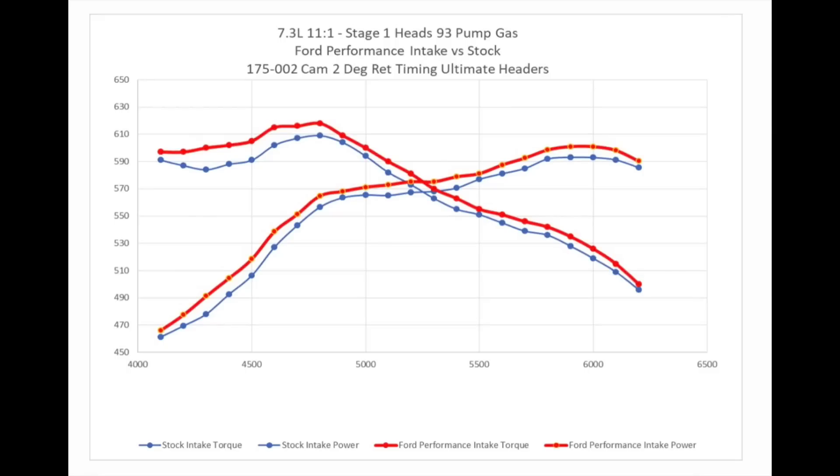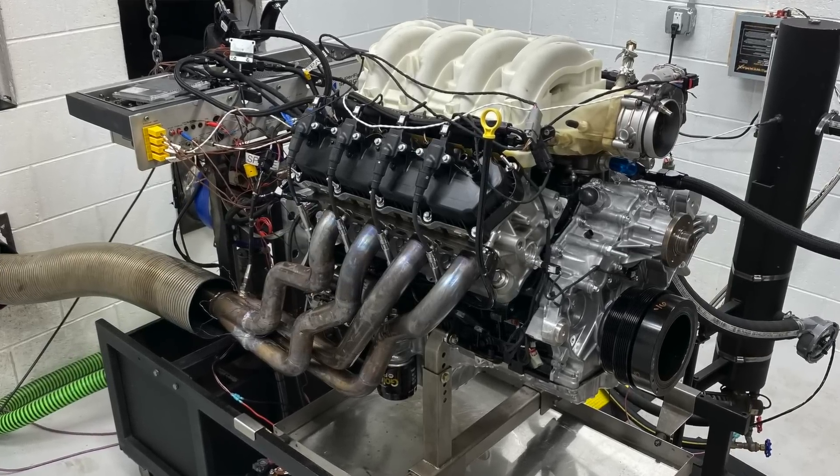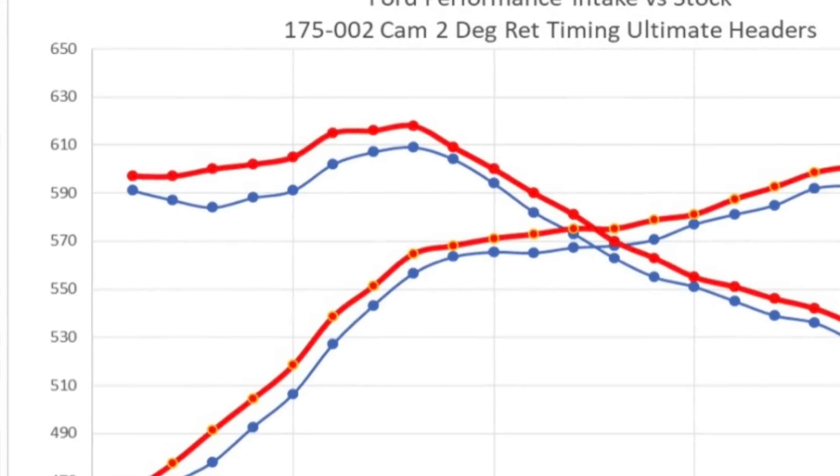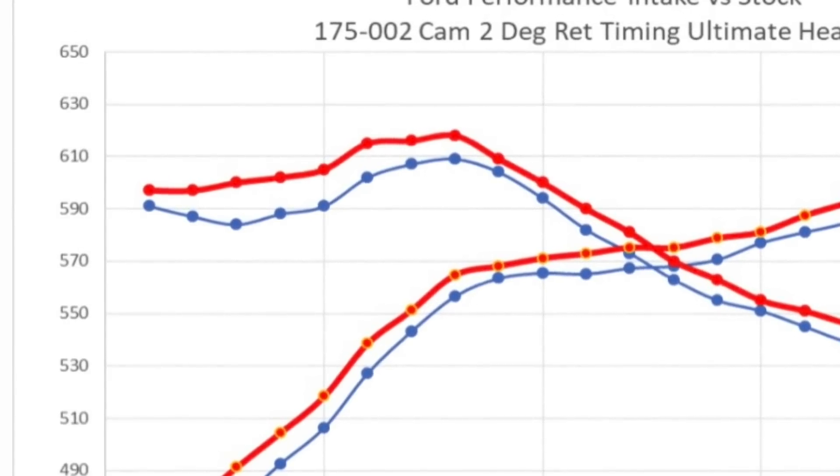Again, the nice thing about that manifold is it's really designed for that 6,000-ish RPM, 6,200 peak engine speeds. As you know, we did that big test with all the cams and all the intakes — lots of big power numbers at high RPM. But a lot of folks want something they can package under the hood of a Fox body or an old Mustang or Fairlane. The cool thing is not only did it not give up any torque versus stock — it actually improved peak torque throughout the RPM range. The peak increase was about 15 foot-pounds, and it also made about 10 horsepower more than the stock intake.